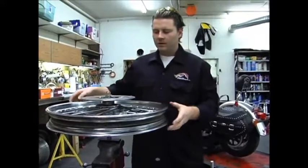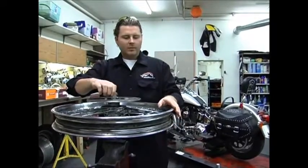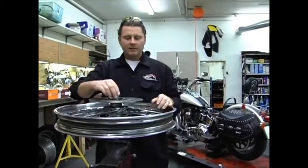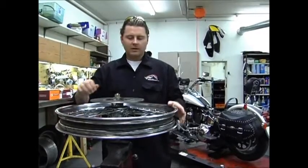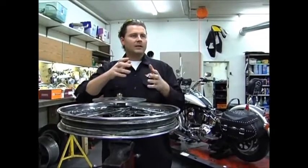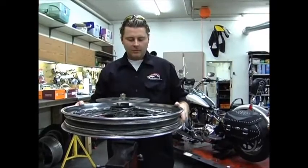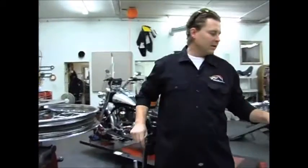This is really important on cheaper wheels brand new — the spokes can be loose right from the manufacturer, and this bearing end play can actually be tighter than it should be rather than too loose. What happens is as you torque your wheel down, if this spacer isn't set correctly it's actually locking the bearings. You ever had a bike that just seems to really push hard? That's usually what this is — the bearings are too tight, not necessarily just rusty.